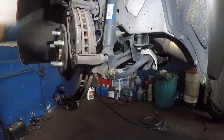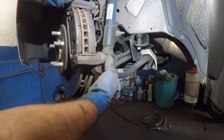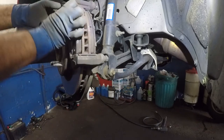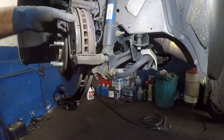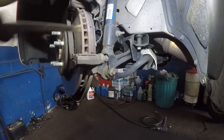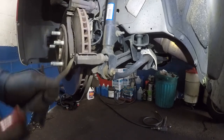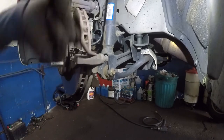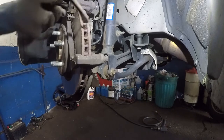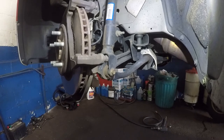If you do not want your brake pads to wear unevenly, make sure your pins are greased up and free-playing. These are pretty good — nice and smooth. Brake pads look pretty good, but the customer brought me everything and said do it because his rotors are bad. While you're at it, if you have new hardware, remove the old hardware clip — bring it up and out.